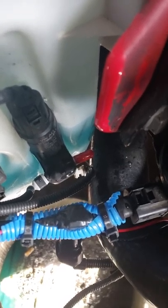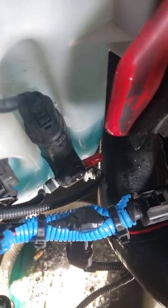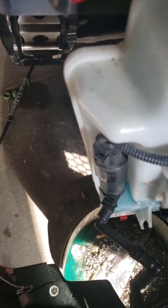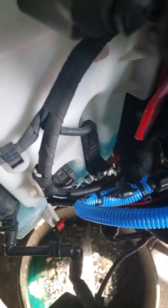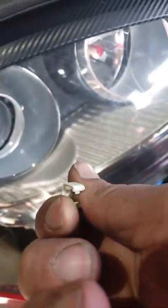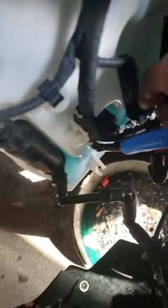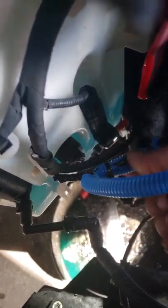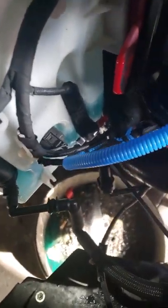This is just so I'm not spraying fluid on accident when I hit my wipers. I'm sure you've all hit the wipers and accidentally turned the rear one on — this will make sure I don't end up spraying fluid inside my hatch. I haven't seen anybody do that on any of their videos, so I figured I'd show you which one it is. You've got the two pumps — that one's for the headlight washers and that one's for the windshield washers. It's the inside connection, and all it takes to get that off is this little clip. And I'll zip tie that to make sure it doesn't pop off.